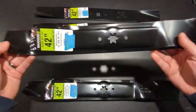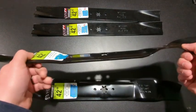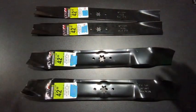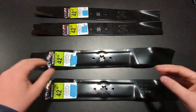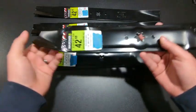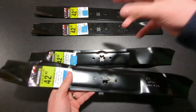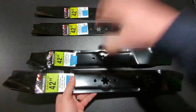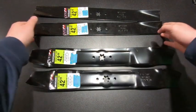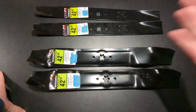So I'm going to switch to the mulching blades. As you can see, the mulching blades have a much different design — they're meant to chop the grass up into finer pieces and direct them back down into the ground, hence the name mulching blades. You won't run a bagger with these; there's usually a cover that plugs off the discharge so all the clippings go back into the lawn. I'll run these most of the season, then swap back to the high-lift blades in the fall to pick up leaves instead of raking an entire acre.